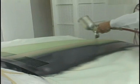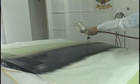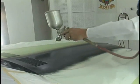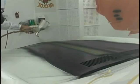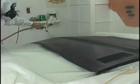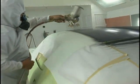Remember, the paint doesn't turn the corner. We as painters have to make it turn that corner. Always remember that. Notice that I'm shooting at that louver from the other side. The reason being, you can't angle the gun the right way to get paint on the backside of that louver. And that happens throughout this whole paint job. We're covered. This is the end of it.